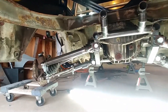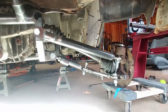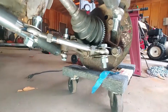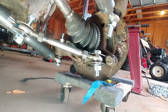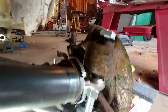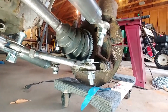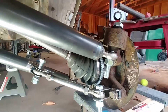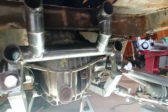The knuckles are out of a newer model Ford Explorer — I believe those were 07 and up. The 07 and up have different mounting: the old ones didn't have any sort of through-bolt mount, they were like tie-rod-style joints where you just slid in a ball joint and clamped it down, whereas these ones have actual bolts you can mount to. I have mine rotated 90 degrees, so I built a secondary mount to keep tension on the toe so it doesn't rotate as it goes through its motion.